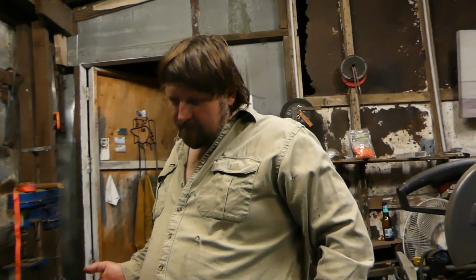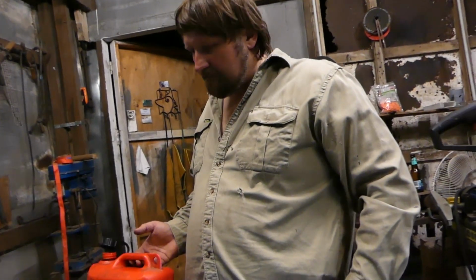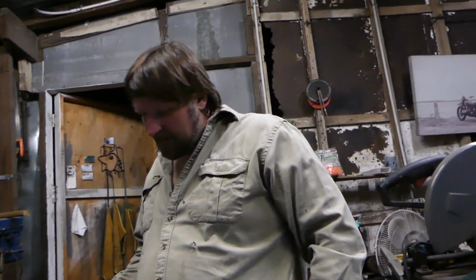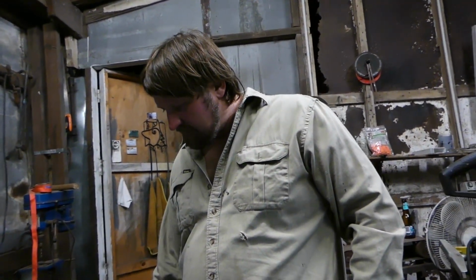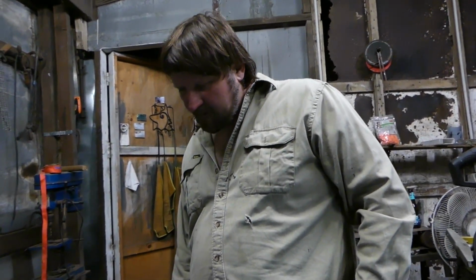I'm happy. You happy? It runs. It does, yeah. Sounds okay. It sounds good. It's just a carburetor issue. I mean, maybe the main jets or something. Each carb's got an adjuster on it. Maybe we can just make sure they're all the same.